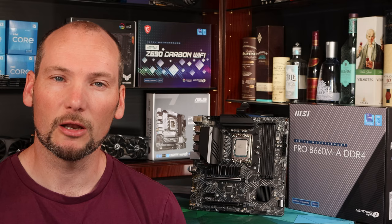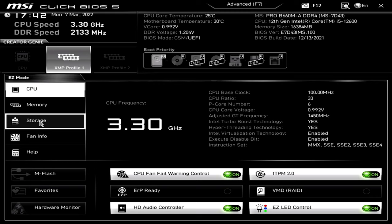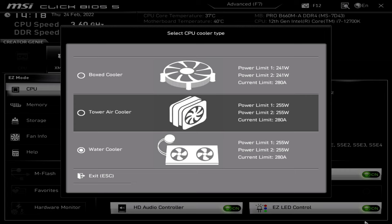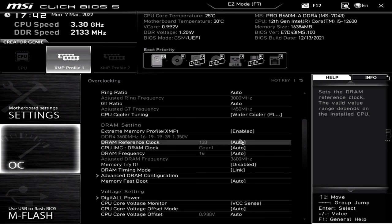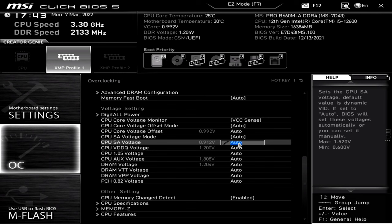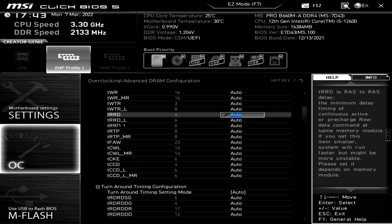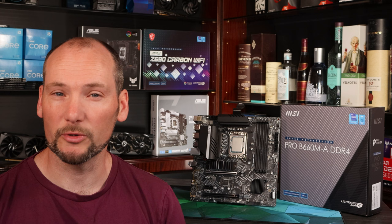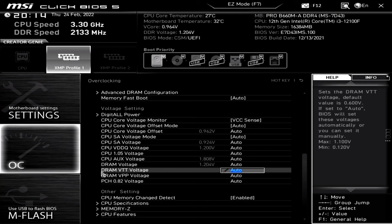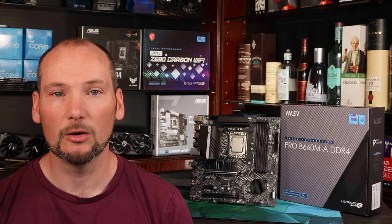MSI's BIOS is well laid out and easy to get on with. There's minimal setup required, but do note that power profiles are linked to cooler type — that's the quick way to set power limits on this board, and it's easy to miss that setting on the initial splash screen. You should check this after setup and follow the guidelines depending on the cooler you have fitted. It will run a powerful i7 CPU at full power if you select the water cooler option. There's easy and advanced modes, and you shouldn't need to do much beyond enabling XMP since there's no official CPU overclocking support. We were able to adjust both DRAM and system agent voltage with a non-K CPU. Overall it's a perfectly good functional BIOS that's easy to navigate, and on a B660 motherboard you shouldn't need to spend too much time in BIOS to optimise setup.